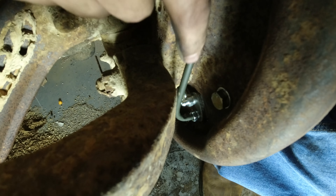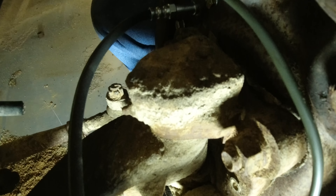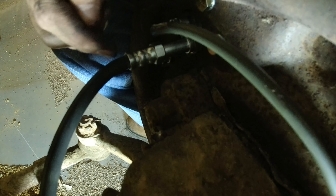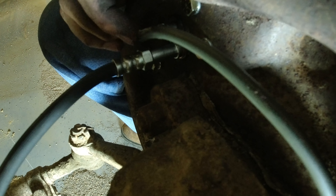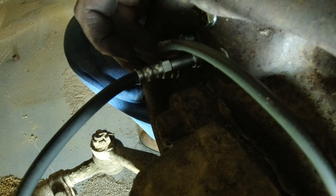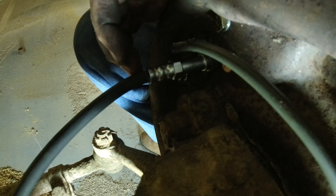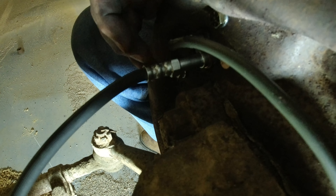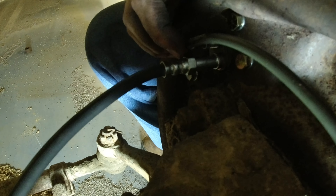This is what I've got going on: I had to make a metal brake line go in down here and come around to this side. This is where the brake line goes from the truck in. There originally was a banjo bolt system, but the way the threaded portion of these wheel cylinders are, they will not take the banjo bolts — they're made for a brake line to be screwed directly into it and it just won't work. In brakes there is no forgiveness — you have to do it right.